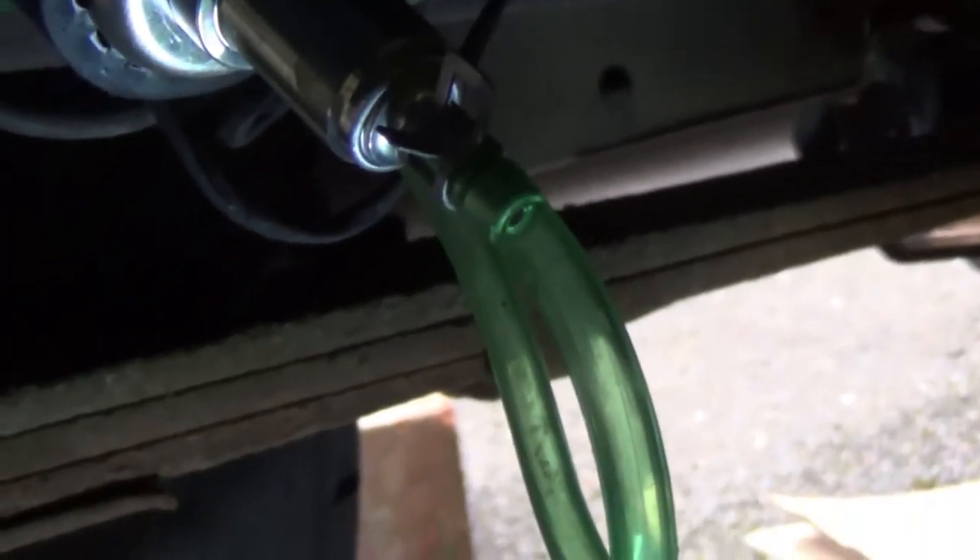The fuel pump, for some reason I can't quite understand, has to be at an angle of 30 degrees — so that's fastened there. Then the inlet to the fuel pump goes down there and underneath that bulkhead, and from there it goes back up into the van. Hopefully you can see the fuel pump there.